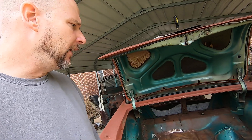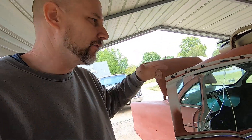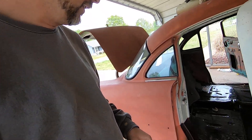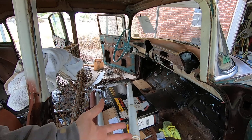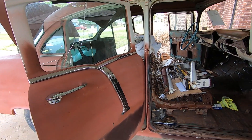I'm not going to buy the patch panel — I'm just going to build it myself, it's not that hard. I did a video on this car at the end of last summer walking around talking about parts needed, and a lot of friends and family stepped up. Several friends with four-doors in their fields just showed up and gave me four-door stuff for free. I've got most of what I need now. The rear floor boards are nice; I had cut-brushed all the floor and brushed POR-15 on it — even did the firewall, toe boards, back behind the dash, and under the dash.